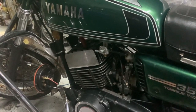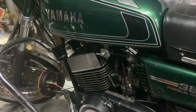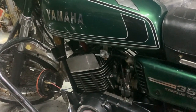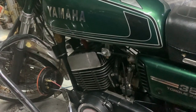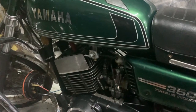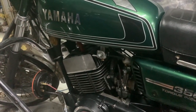I'm hoping there's nothing wrong at the crank. I'll check by removing the silencers — I'm trying to procure a borescope to send through the exhaust port and see if the crank has too much oil, since it's a recently built engine and there should be zero oil there. If that's the case, I'll take the top end apart, paint the head, and drain the excess oil from the crankcase. The lesson: only fill the recommended amount of oil — anything over that will put you in trouble.